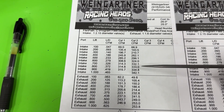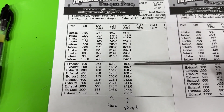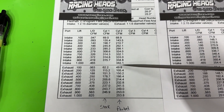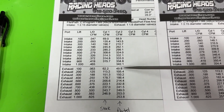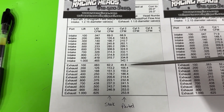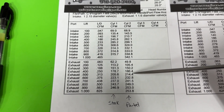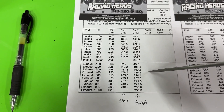We've got a beast — especially in a standard port, non-shaft-rocker-required package. The exhaust flow is pretty good even with a 50-degree valve job. Apologies — the air compressor decided to kick on. With a 50-degree valve job you expect to lose some low-lift flow, which it does — at 0.200" it really did drop, though it's not that horrible. Killing low-lift exhaust flow is actually better in my opinion because it helps with reversion. But at 0.400" it's better than stock, and from that point on it's really really good.